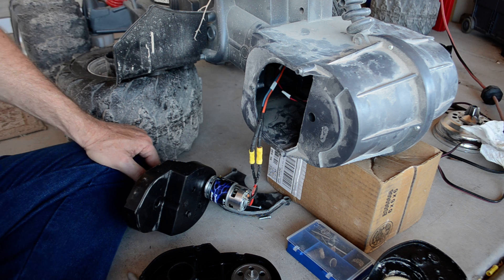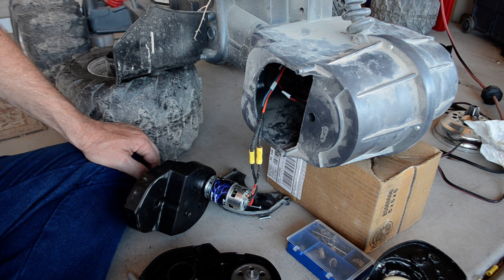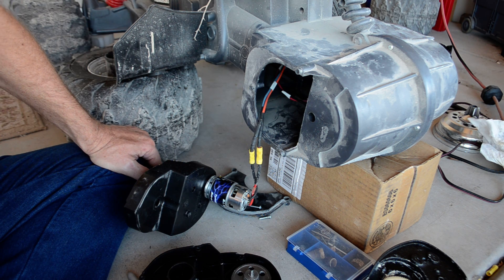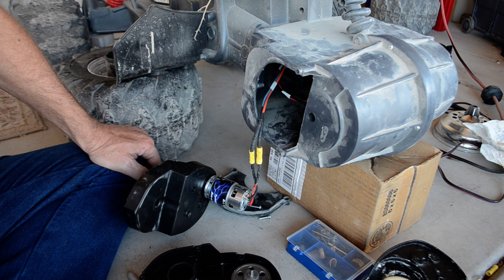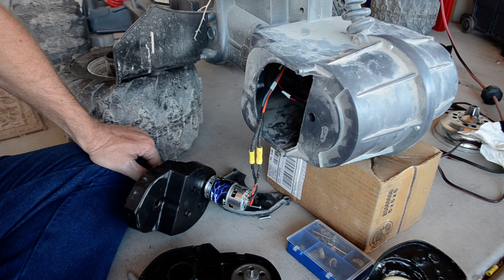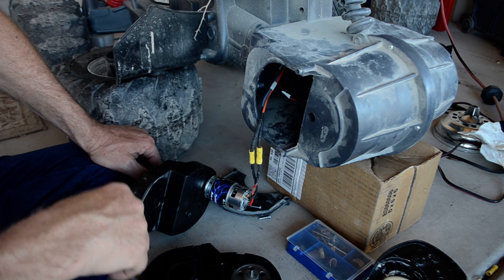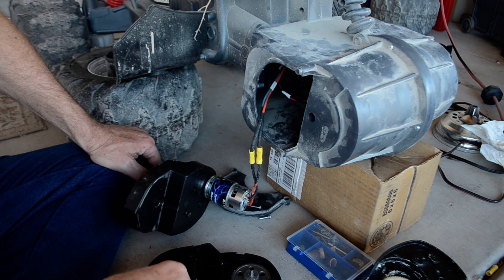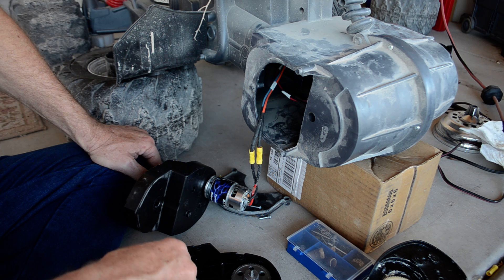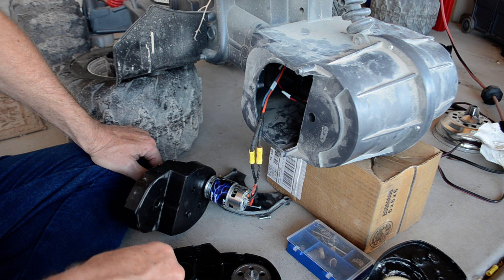With a little vehicle like this, if you have power on one wheel and everything else slides, you can't steer it. After about 25 feet I told my son we'd fix it. So I took it apart to investigate. They said 'Maybe you got the wires crossed' — no, it's just forward and reverse, it's a DC motor. Then they said try swapping the motors side to side. I did exactly what they said and ended up with the same problem but now on the other side.